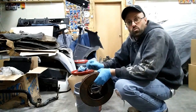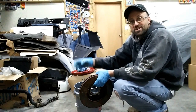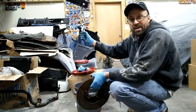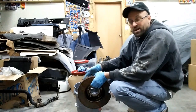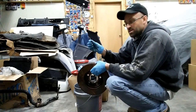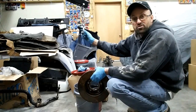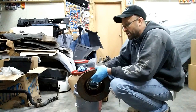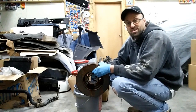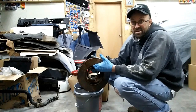The second benefit is that when it's washed off and you want to dip it back down in the solution and then hang it — you can see I've got my engine hoist here hanging over the solution — I can pull it up, hook the loop I've tied into the wire over the chain, and let it drip dry and air dry. So the solution takes off all the rust; all I do is wash it, dip it, let it air dry, and it's protected.